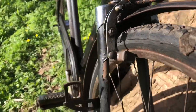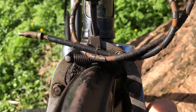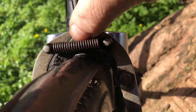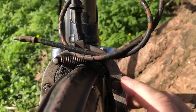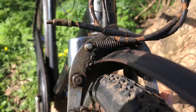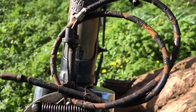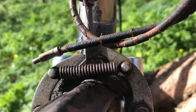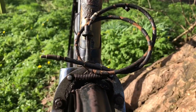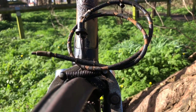Now let me turn the wheel so we can see it in the sunlight better. These are the patented New Hudson centre-pull brakes — they're like what's known as a bell crank. You pull up on this cable and it pulls a bell-shaped crank, which pushes out on the arms, which pivot on here and go onto the rims, with the return spring there as well. The cable is wrapped up in its original housing, which unfortunately is knackered. It's a double-ended cable with a pear nipple inside the saddle, which I'll show when I take them apart. The nipple on this end has snapped inside the lever, so that's one of the things that needs doing — I need to make up a new cable with pear nipples on either end.